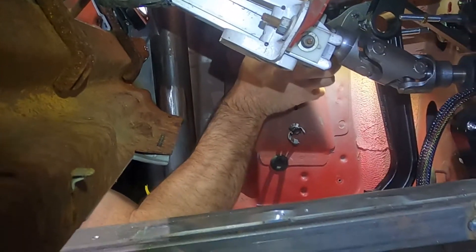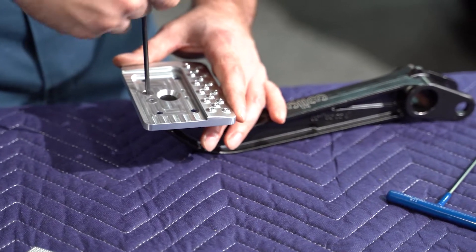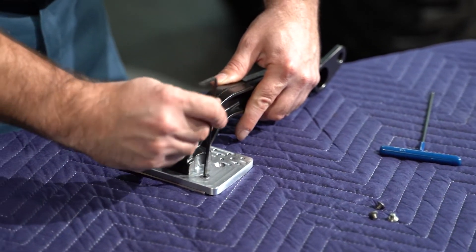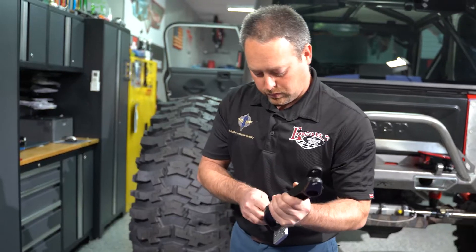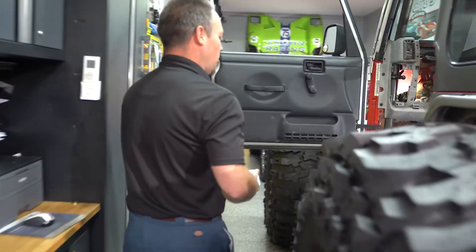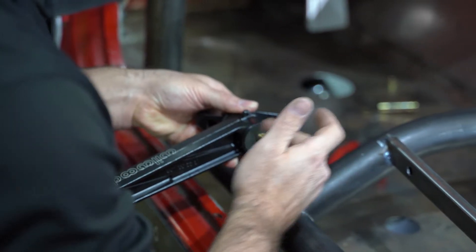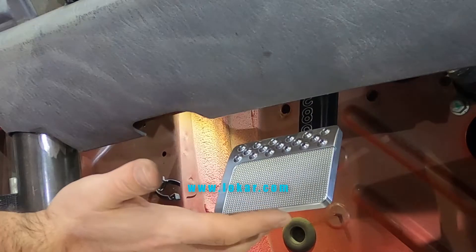So we've got the Wilwood arm off. You can see the four-bolt pattern there — it comes with a small pad on it. Kevin did the Goolsby Edge Edition pad, which is this one. It won't fit on there stock, so I had to modify it. I had to come with a half-inch stud on the back, so I just machined that off and counter-sunk two holes going by the old pad-bolt pattern. This is a prototype, so we're going to have to take it back and do some machining. That way it'll bolt on really nice.